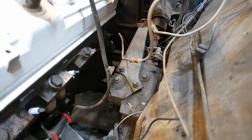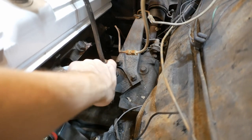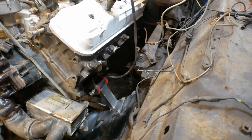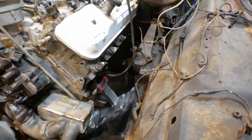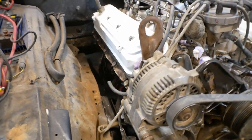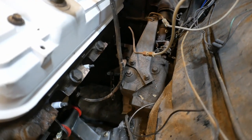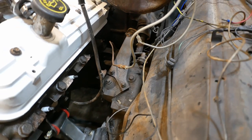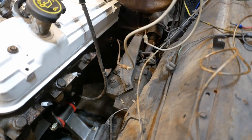And that manual steering box did interfere a little bit with the dipstick here and how the dipstick mounts to the exhaust manifold. I currently have the exhaust manifolds off, but they do fit. They do actually slide onto the truck and the engine at this point, so it's not as though you can't use those acres of space over here on the passenger side. So there was only that little issue there that could be resolved with using a bolt instead of a stud, or even just removing the shroud here, I think would probably do it. But your power steering box might differ